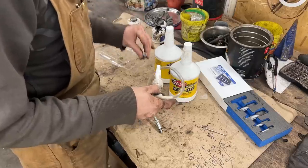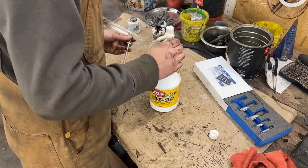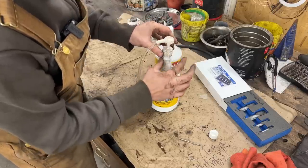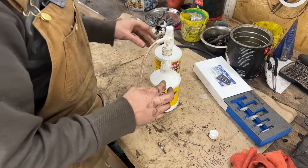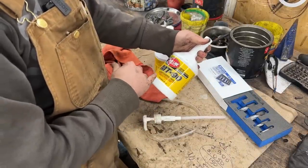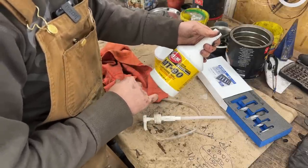It would have been helpful if I turned my mic on for this clip, but anyways, I was just saying that the best way to fill up a differential or transmission with oil as they are on the car is with a little pump like this, which can go directly on the oil bottle. Even if it doesn't fit on the threads for the cap, it doesn't necessarily need to be closed. You can just put it on top and still pump it. This is the oil that I'm using, MT90 by Redline. It's a GL4 oil, which is recommended for differentials. That's the one that I like.